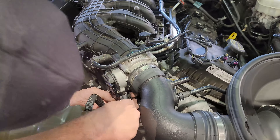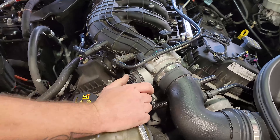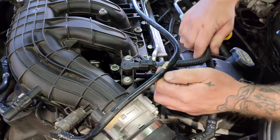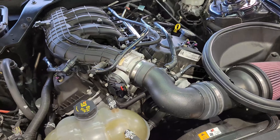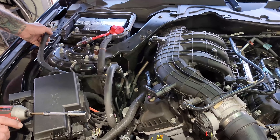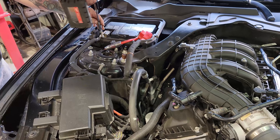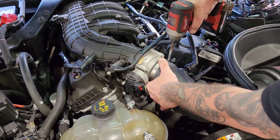Don't forget to plug in your throttle body. Now that the intake is all bolted back up, go ahead and reattach your ground side to your battery and tighten it up. That concludes our video on how to install your fuel injectors, prep them, and get some new injectors on your car to run E85 or prepare for boost. Thanks for watching — make sure you like, share, and subscribe. Comment down below if you need anything or want a set of those injectors and we'll get you hooked up.